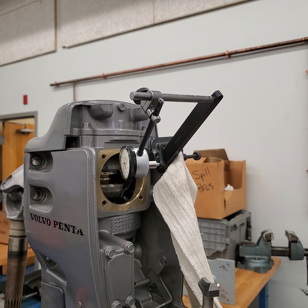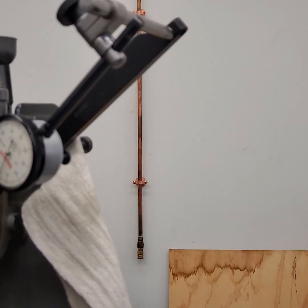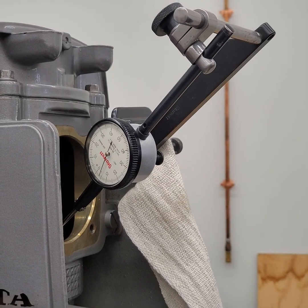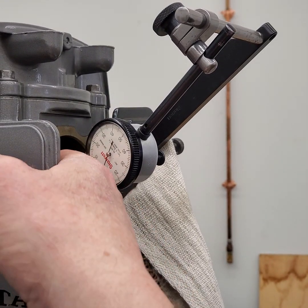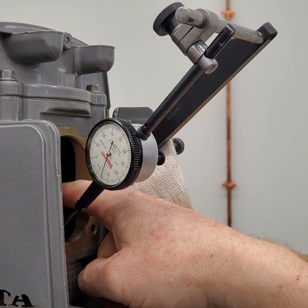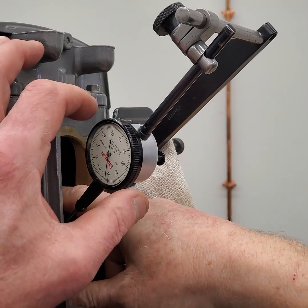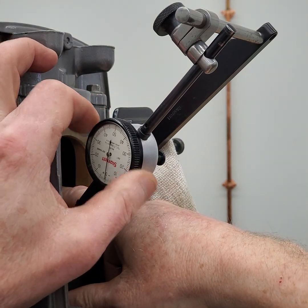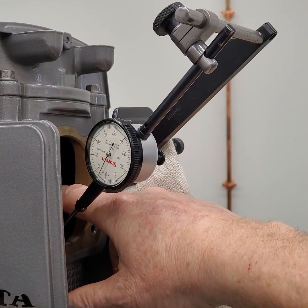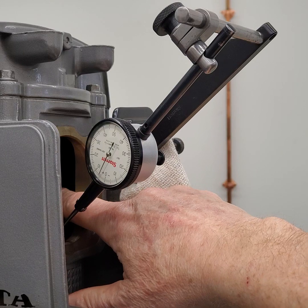You'll be able to see the indicator — I'm going to move over a little bit so you can see the indicator and zoom in. Then what I'm going to do is reach in on the top of the cone, go on the other side, and just rock that back and forth. When I get it to one position I'll zero the indicator and then read on the other side.